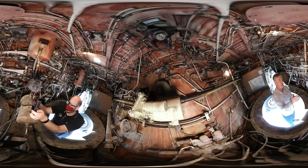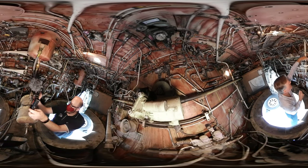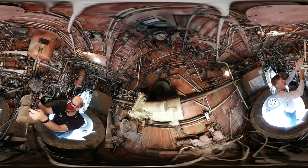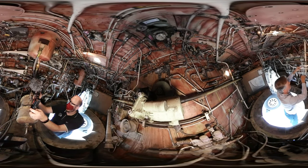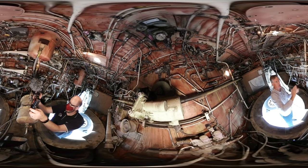They are also spring-loaded back to the neutral position, and that's done by a cam which is attached to this aileron input shaft. The cam is a sort of concave triangle shape — there's a dip in it where the roller will naturally want to sit, and that's your central position. We can adjust that central position with aileron trim. If aileron trim is moved in the flight deck, it actuates this little motor here. Behind the motor there's a little push rod, and that physically rotates the cam and this whole aileron feel and centering unit round, so that it adjusts the neutral position for the ailerons.